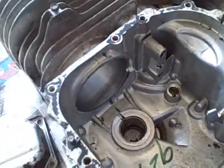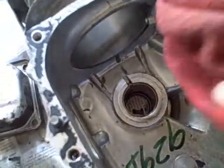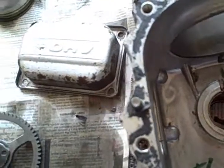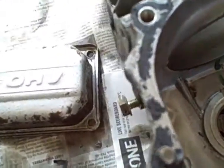Let's go ahead and clean all this up. I'm just starting to clean and I was wiping the cylinder down here — this is the one part of the engine I have the biggest concerns with. When these Briggs engines go and they break inside, you have all kinds of problems. Look at all this metal and all the fragments — just tons of it inside here because it's an aluminum cylinder.